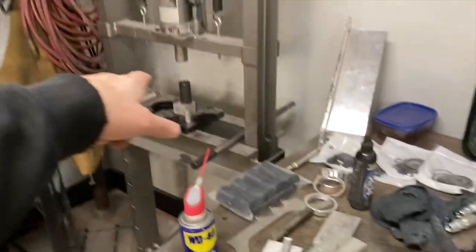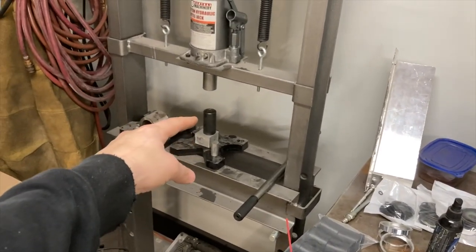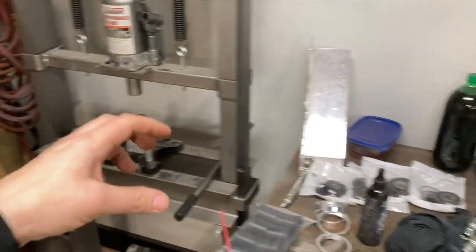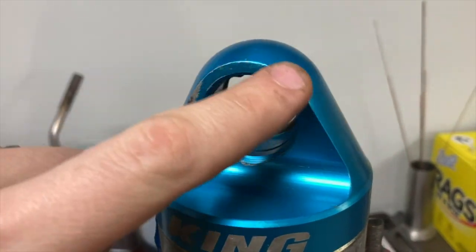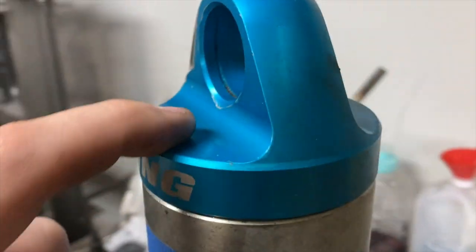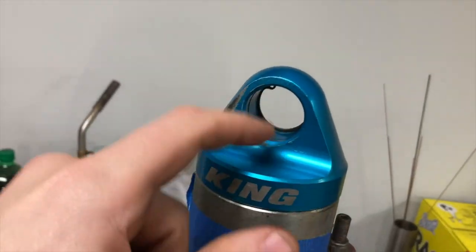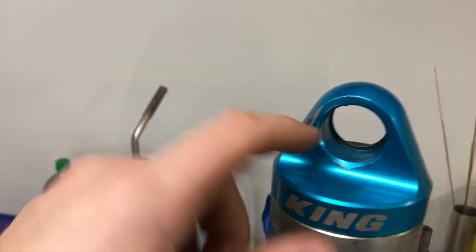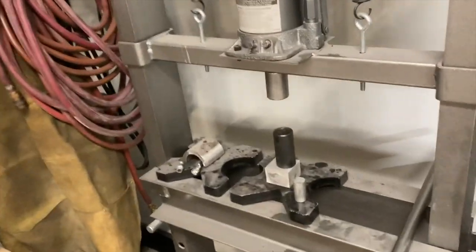And then the other thing is, maybe in the time lapse there, if you saw me using the torch on the press for pressing these things out, I like to use a socket. I just get a big heavy duty impact socket, a little thicker walled, find one that fits this size, fits right around there. Because with that radius, you don't get much to press against. Once I get the one out, I like to put a little pressure on there. I set that on the impact socket.